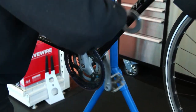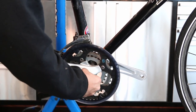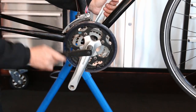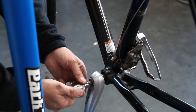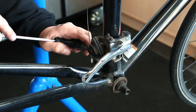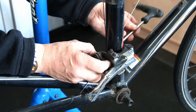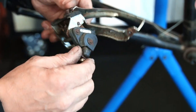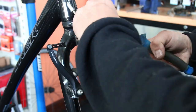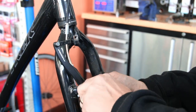The pedals on this bike - the little screw fittings have gone rusty, so I'll swap those out. You want to get rid of as much rust on a bike as possible. I'm going to replace the bolts that hold the pedal arms on because they're rusty inside. I also always change the cables on all the bikes, because as a retailer I have to offer a warranty by law on any bike that I sell, so I make sure there won't be any problems.